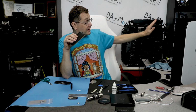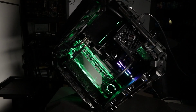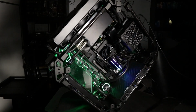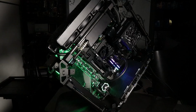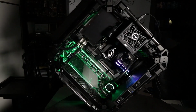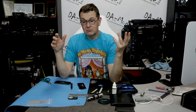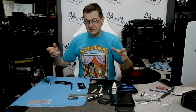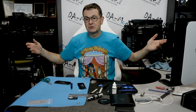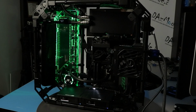And what I want to do, I keep fixing my German skeleton build, and the problem that I experience is that I have a Corsair Dominator Platinum RGB memory, which has cool lighting and you can do fancy stuff with that, but to make it work you need an absolutely horrendous piece of software called iCUE, which doesn't integrate well with ASUS. It interferes with Windows, so it doesn't go to sleep properly, and also it works only right every second time you start the computer, and iCUE simply doesn't see the memory. It says you don't have any memory installed, so you need to reboot because restarting the software doesn't help, and then it suddenly sees the memory, you need to open it, apply the lighting effect, and then you have whatever I configured.